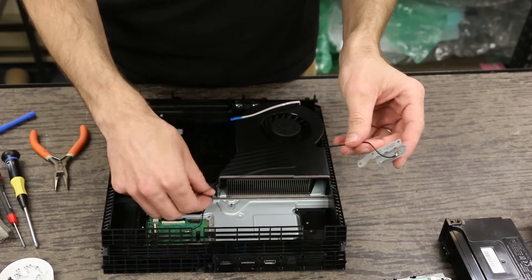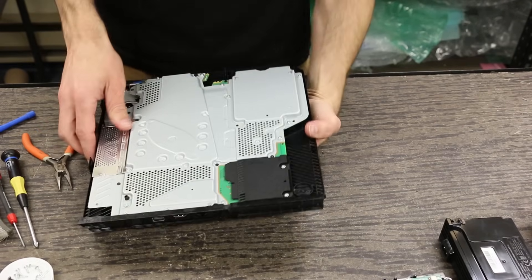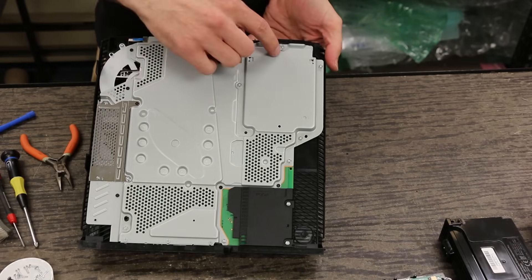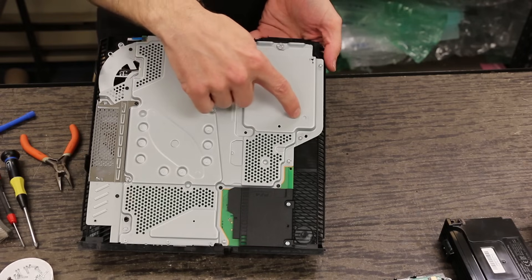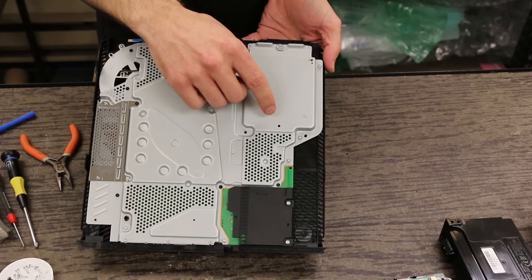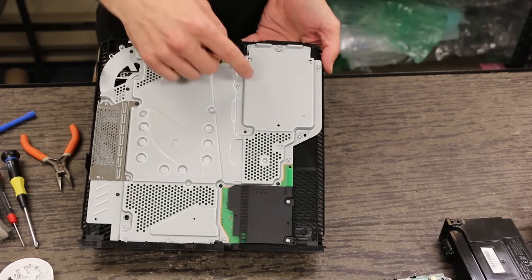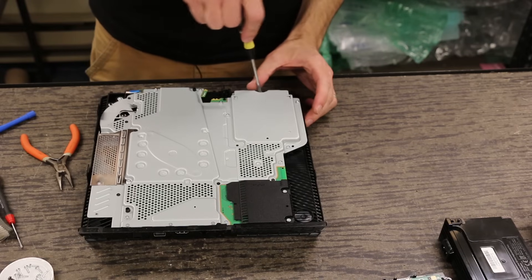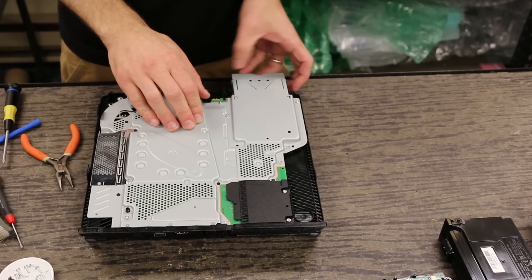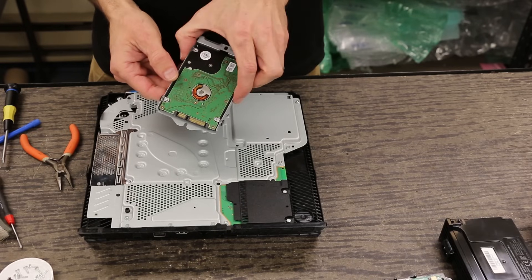Now that the Wi-Fi cable has been de-routed, we're going to tuck that under there and make sure not to get it bent when we flip it over. The first thing we're going to do here is remove the hard drive. I also want to make a note: when you remove the hard drive, this hole right here with two arrows on it is for the manual eject for the disc drive. I've seen places online that say there is no more manual eject, but there is — just remove the hard drive and there's a screw right down in there; you just twist and that will get your disc to slip back out. As of this video publishing, there were 500GB hard drives in these new models; I'm assuming very quickly they'll move to the 1TB, but I don't know for sure.